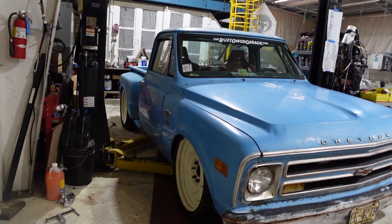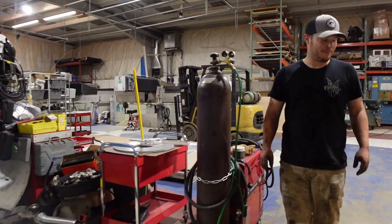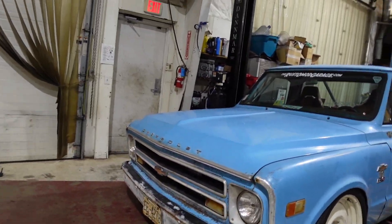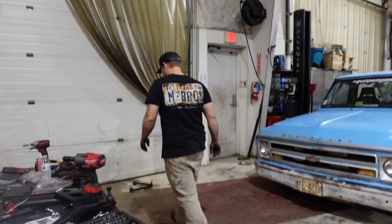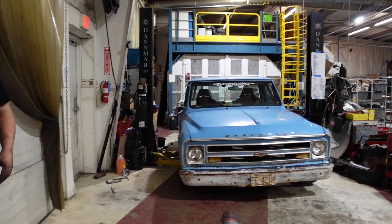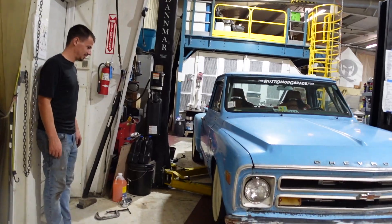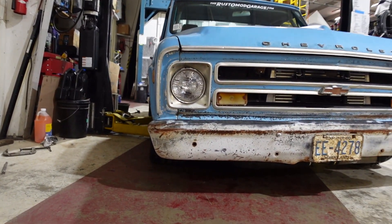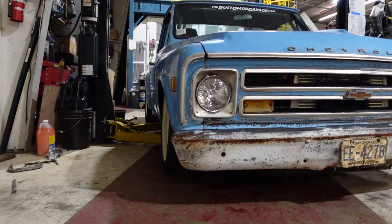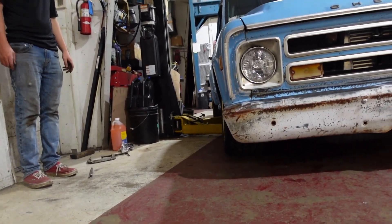Oh my gosh — you're tucking. That poor axle is maxed out. She's slaying. The whole truck is just… I don't think it really fixed the camber because it's that low. It lowered it an insane amount — probably three or four inches lower than it was. It's a drop control arm. The camber is still cambered. I gotta raise it up — let me raise it up like three inches and that'll help it some.